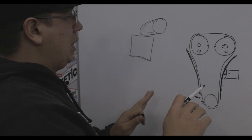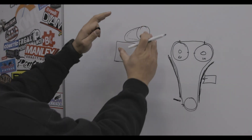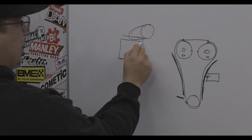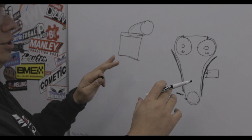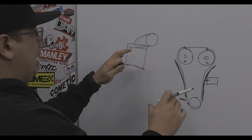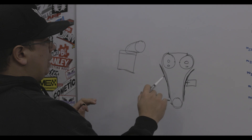Some engines use different colored chain links to set timing, but on this engine you just lock the crankshaft into service position and line up the exhaust and intake gears. Regardless of what the cams are doing event-wise, that does not matter, because the chain links are always the same relative to the exhaust and intake gear. What happens is: on a stock cam with less lift and duration, the lifter could be in a resting position. As the cam gets bigger, it puts more force on the lifter bucket over a wider range of time.